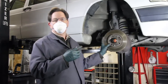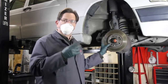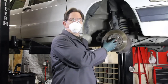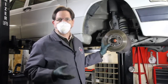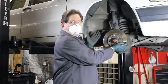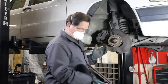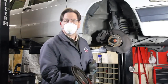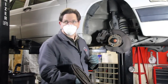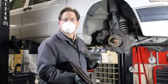Here are a few tips when working around these brake rotors and calipers. What I like about the 201 and 124 chassis is you can pull the front rotor without having to remove the whole hub like you did on the older models. There's a screw you remove, and once you've removed the caliper and hung it, you can just remove the rotor - the front ones come off quite easily. But not the case with the rear ones, which can seize because of moisture and rust.